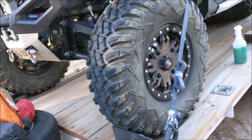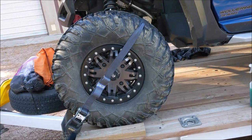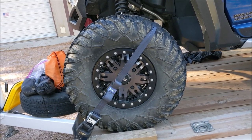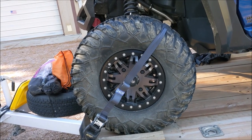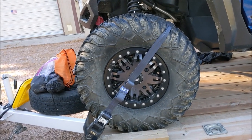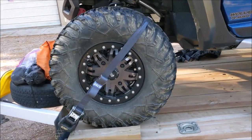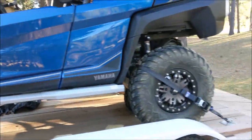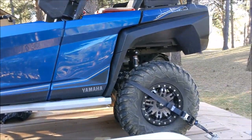So to summarize securing the trailer: get as close to the wheel as possible. You don't need tire-specific bonnets to achieve that effect, and you want to have opposing forces — I don't want to tie both straps in the forward direction.